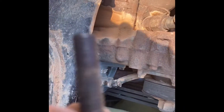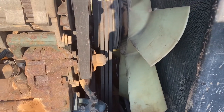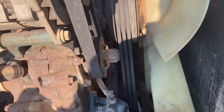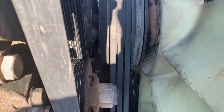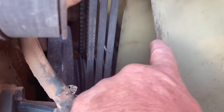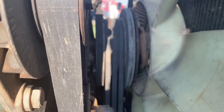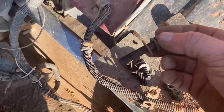You've got four of these coming out — the nuts aren't coming off alone, the whole stud, washer, everything is coming out of there. Also a quick diagnostic story: the first thing we checked is the solenoid up there. Pull the airline off, hit your fan switch on and off — if you've got air coming out, your solenoid is working. Next, put your airline back on, truck off and aired up, hit the fan switch, and if you hear air leaking out you know you've got a busted seal. You can see this oil around here — little tattletale signs of oil on the fan — so we know we've got a blown seal in there.